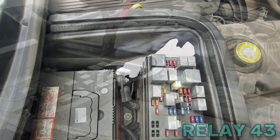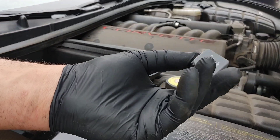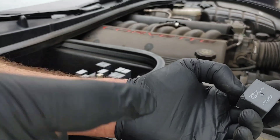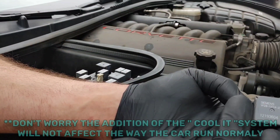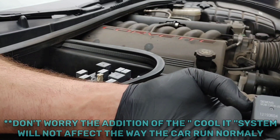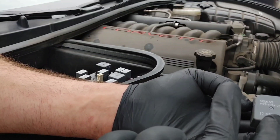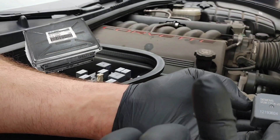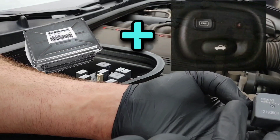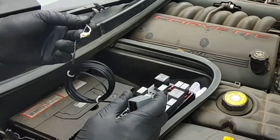First I'm going to remove this relay. The relay is the part that sends power to the high-speed fan. Even if you install the new relay with the switch, the computer will still be able to turn on the high-speed fan automatically if it reaches 230 Fahrenheit. So in this case, we'll be able to have the computer turn on the fan, and with the switch inside the cabin you'll also be able to turn it on when you want.